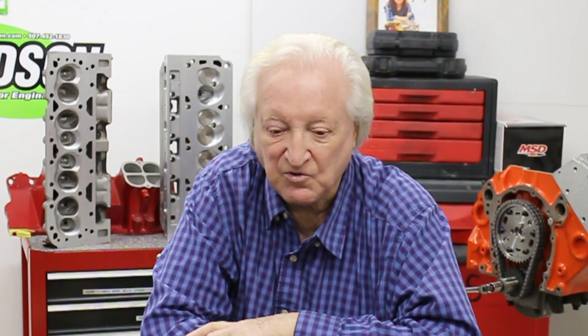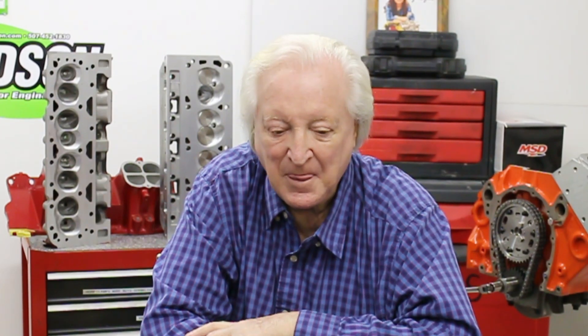Here's what I learned: first, a timing chain which is too tight costs you power. I don't think it's all friction — I think part of it is that a tight timing chain transmits crank torsionals straight to the cam with no softening between. The engine had a good damper on it, so it wasn't a case of not having a damper to damp out those vibrations. Secondly, I think when the tension is on the chain, the friction of driving the camshaft is up — so there are some parallels there, but that might account for only about two or three horsepower.